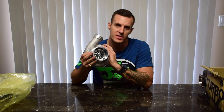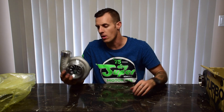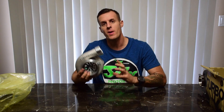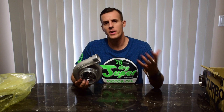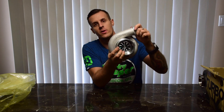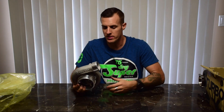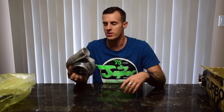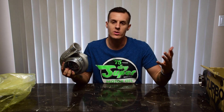That increased airflow is going to help the turbo spool up faster and make more power. Another cool feature of the Gen 2 product line is you can buy these turbos in reverse rotation. So if you're running a twin turbo setup, you can run two turbos facing opposite directions where the compressor outlet faces two different ways. Usually with a twin turbo setup where both housings face the same direction, you can have trouble routing charge pipes to one of the turbos — but with the reverse rotation option, it makes running the charge pipes much easier and looks way more symmetrical.